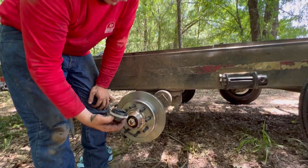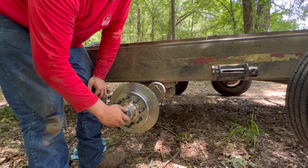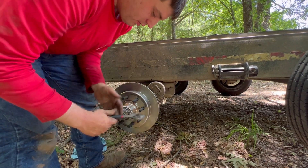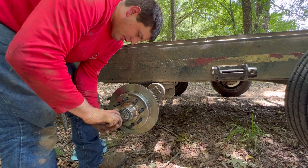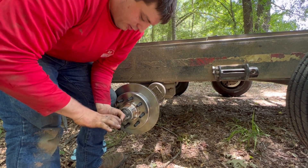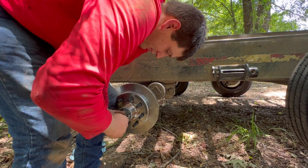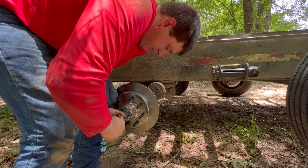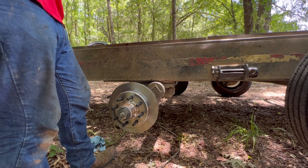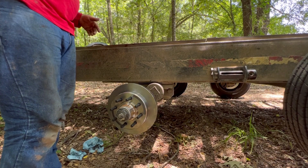Get the cap - I don't ever worry about the inside of that. I've cleaned them and not cleaned them, it don't make a difference. These caps aren't meant to be torqued down hard because they're plastic - you'll break them real easy. Just as long as it's snug, you're good. Now I'll get my Loctite caliper bolts and put that caliper on there.